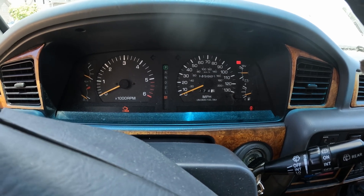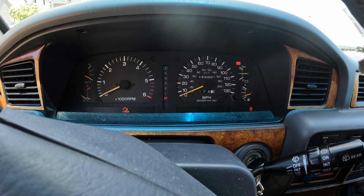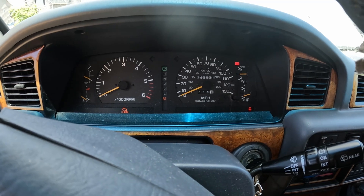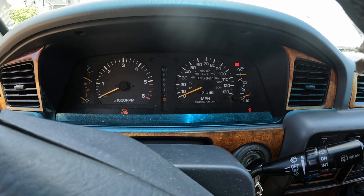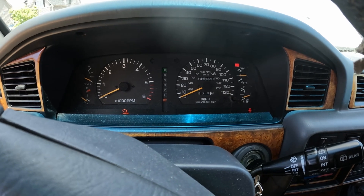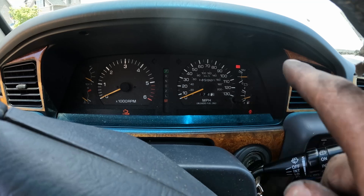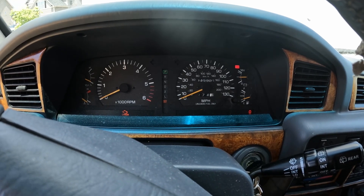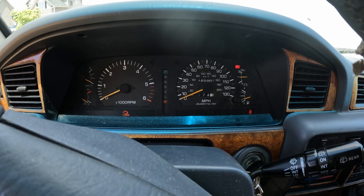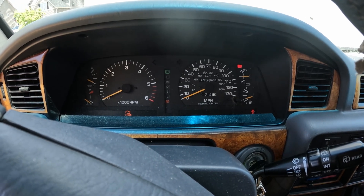There are other reasons why you might get a crank no start. You could have a camshaft sensor or crankshaft sensor issue in the later models, a mass airflow meter problem, or a fuel pump problem. But it all goes back to: let's first take a look at what our dash is telling us. I'll put that document in the description so everyone has that list of things to check if your 80 series fails to start.